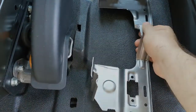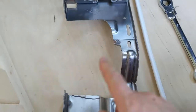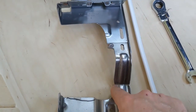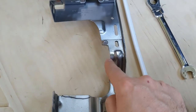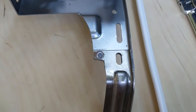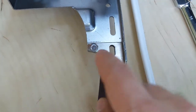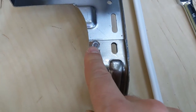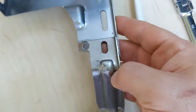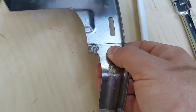So I had to cut a couple more pieces, more than I thought. Just use this as a guideline — this is a straight cut, and then come right when it starts to turn here, you want to go up and then over right here. There are three tack welds; that's actually holding all of this together. I left one tack weld in place, obviously, or this piece is going to separate from the other piece. And then I'm going to run a little bolt and nut right there.